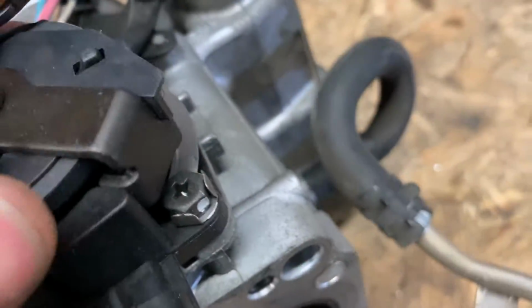So, okay, I bought a drive-by-wire delete from Drift Motion to make this just drive-by cable instead of drive-by wire. Where I'm running into confusion is that if I do the drive-by-wire delete, then I have to buy an aftermarket remote idle air control that I tap into the intake so that my car starts easily, and I don't have a problem in the winter. So I need to do that, or I decide on just keeping it drive-by wire.